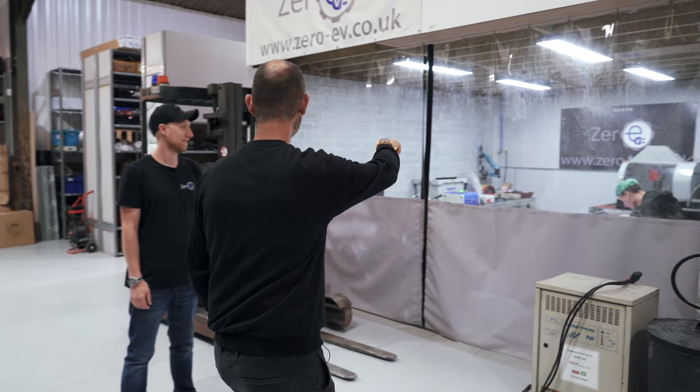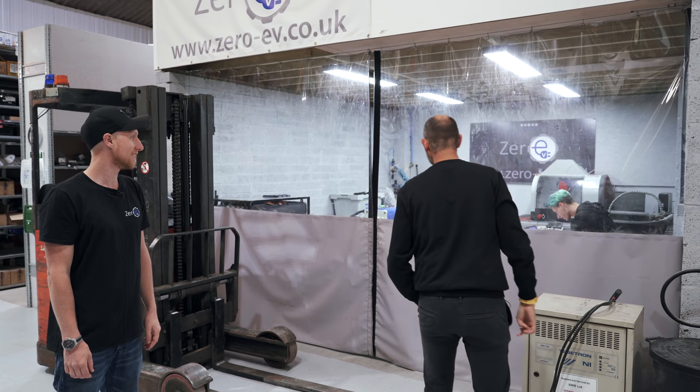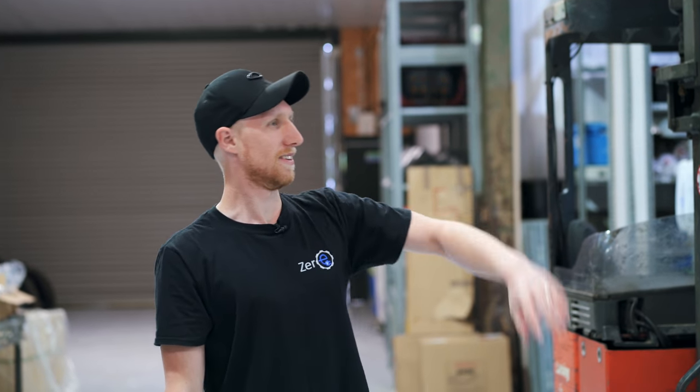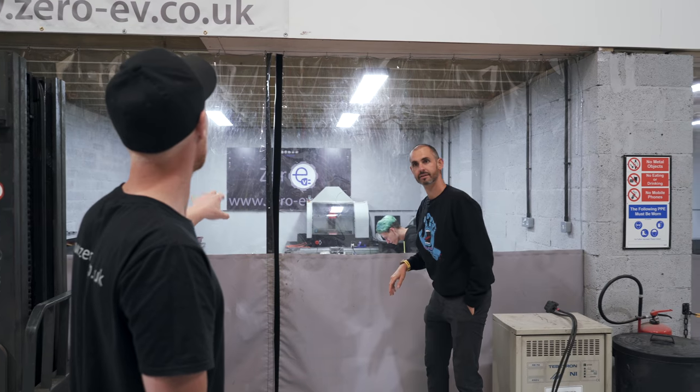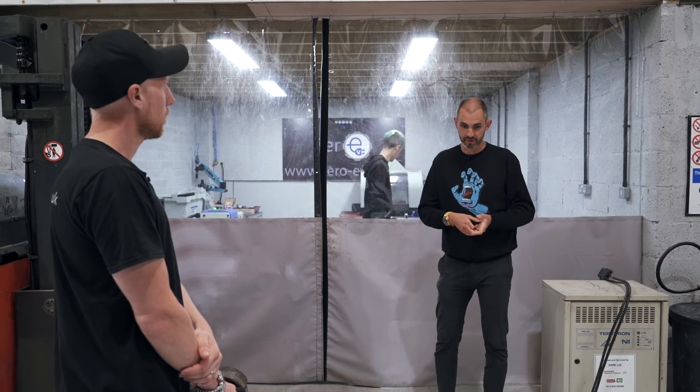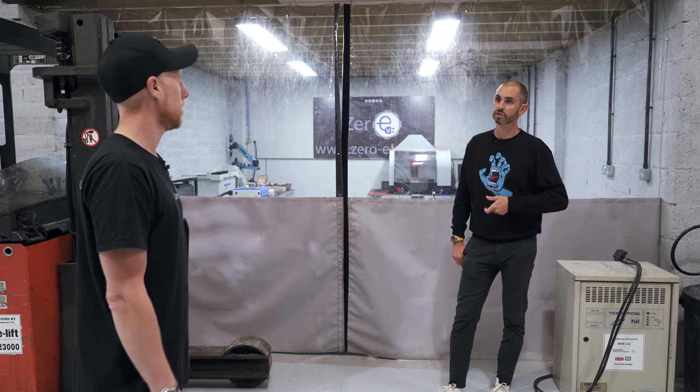That chamber there — that's CCS development. There's a CCS plug and a big battery pack and a CCS fast charger. Which is great because having a classic car that can CCS charge means you can run a smaller pack. You don't have to put the car over weight, and you don't have to spend an extra £5,000-£7,000 on batteries that you're only going to use once to go a long distance. You can just top it up quicker. So a car that can do 100 miles on a charge is perfect for round-town stuff, and if you do want to do a longer trip you can fast charge it super quick anyway.